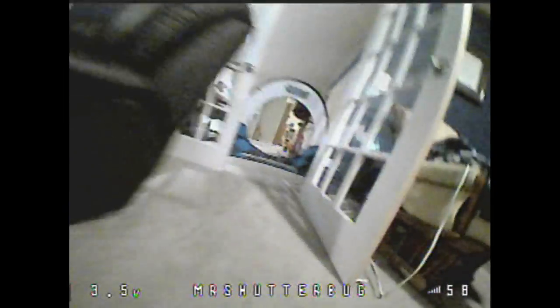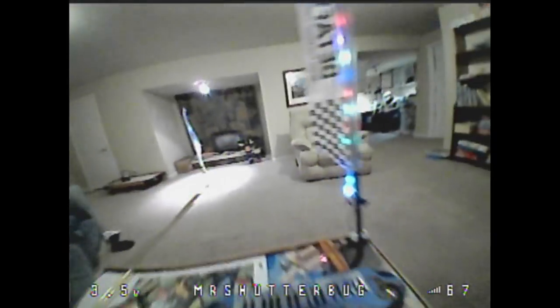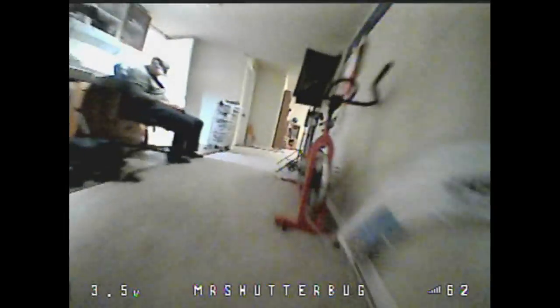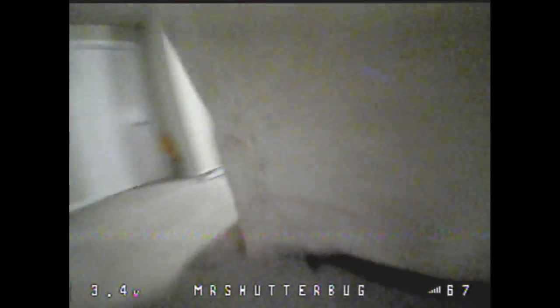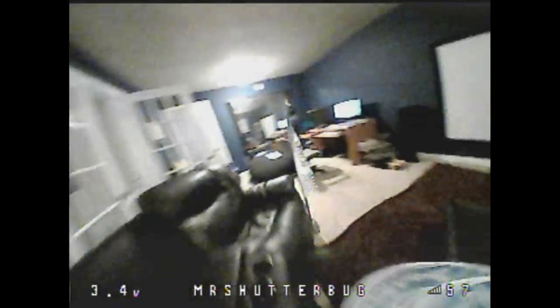The speed of this drone is kind of overkill for the size space that I'm in, but it is pretty fun. When I fly fast like this, I get between two and two and a half minutes of flight time, which is not very long. The batteries do tend to come down pretty warm. If you're into competitive racing with the two-minute racing format, you may or may not have enough to finish that last lap. You might want to consider using a slightly larger battery — that's what I did two weeks ago at Sumerian Brewery, using the MyLipo 333, and I was definitely able to finish strong even using the PH2 connector at the time.